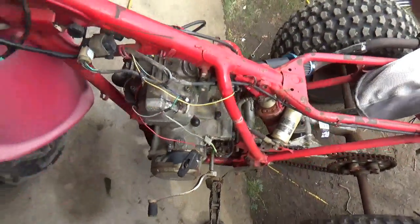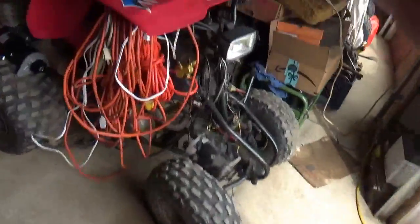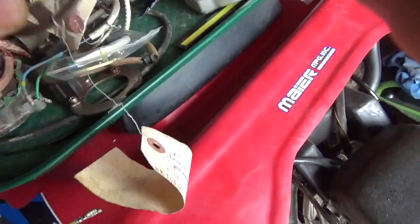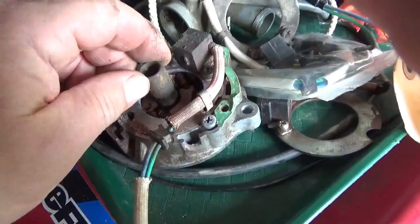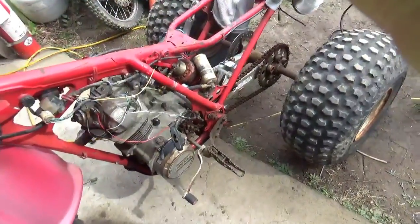If you guys recall, inside the pulse generator cabinet, whatever you want to call that, it has this pulse generator. I have it wired so it doesn't advance. And I just went through the hoard, and this is a pulse generator. I bought it, right? You can see the tag on it. And I put my own springs on it. Those springs are a little too strong. Looks like I have the accelerator part with the right springs in it, but I have no top to put on it. So hopefully I could borrow the top, the magnet part, this piece, and put that on there, and I think I discovered I had one complete one floating around that I could also use.